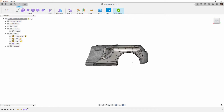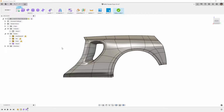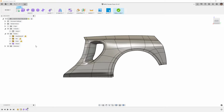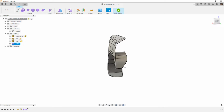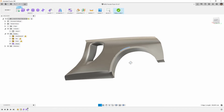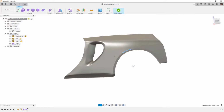If you're following along or if you're making your own, at this phase in the design, what's going to be really important is adding the major defining lines for your shape. So obviously the intake scoop was critical because we've got some matching features on the door, and we need to sort of carry those around our design if we want to maintain the design continuity between the original car. And also things like this detail that's at the bottom of the skirt, because we don't have an additional add-on skirt. We're transitioning from the stock. And then this stylized line or this feature that's controlling the shape at the top. These are the major defining curves. And obviously we added that little lip around the fender, and that's kind of a standard feature that we want to do. But at this stage, I think it's looking pretty good.